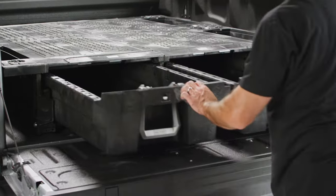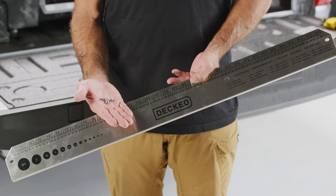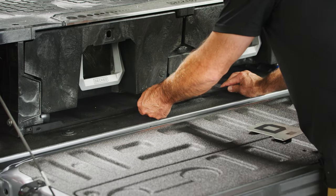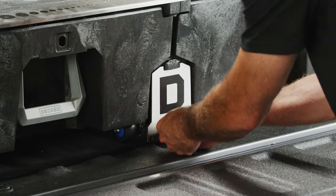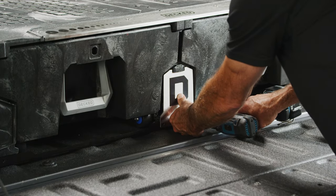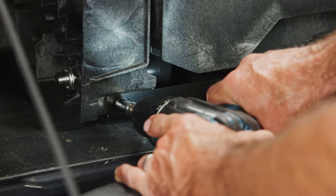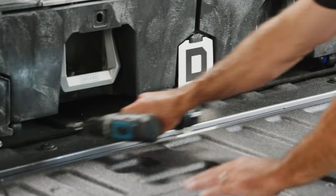Step 7 — Put the mustard on the dog: install the ruler with four 3/16 hex drive screws — don't over-torque, just get them good and snug. Position the torsion brace so that the side with holes is facing you and the side without holes slides underneath the system. Slide the top of the cod piece under the tab on the center vert, hold it in place, and install two 1 inch by 3/8 hex head screws through the cod piece and torsion brace loosely. Attach the torsion brace ends with the same hex screws, leaving them slightly loose. Check that everything is straight, then tighten all four screws down firmly.